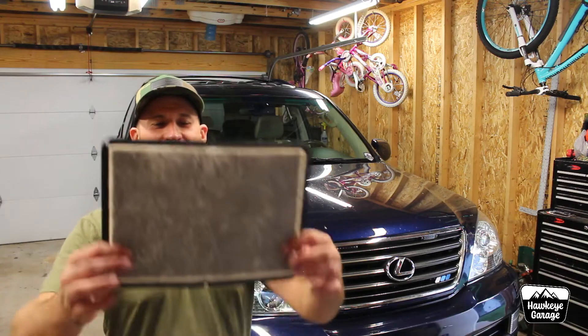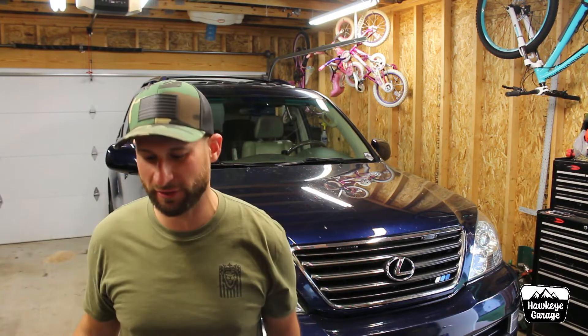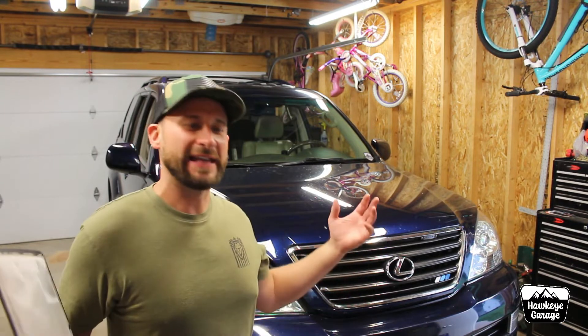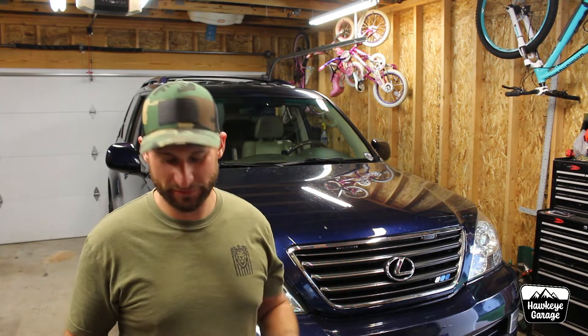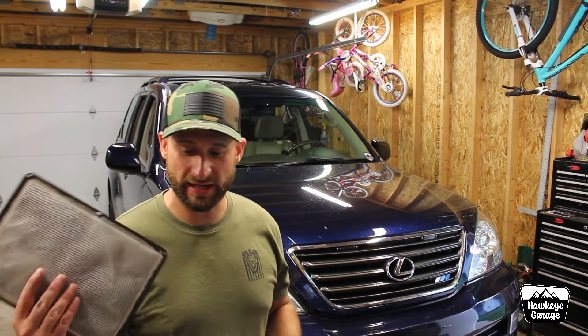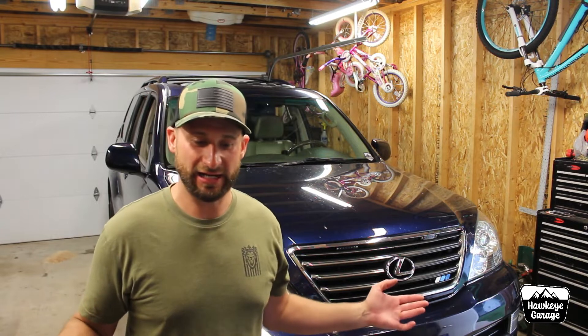This is the charcoal air filter — pre/post — because it actually comes after the air filter. They come in a lot of Toyotas and GX. My 4Runner had one. Essentially, this is to stop gas fumes from coming back out of the engine when the engine is turned off, and therefore possibly causing a fire. I've never heard of any other vehicle having one of these, and then after I cleaned mine, thinking it was possibly contributing to the issues I was having, a subscriber I trust said they had removed theirs with no ill effect.